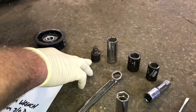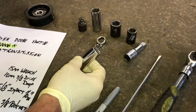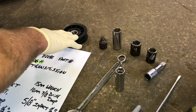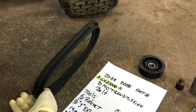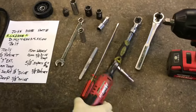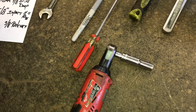I'm going to use an adapter because I'll be using an electric ratchet. We have a 15 millimeter for the back guide on the transmission — we have to take that off. We also have to replace one of these pulleys. They only have a flat idler and a V idler on John Deere's website and you'll see why we're doing the V idler. This is the transmission drive belt, and I'd recommend when you take the old one off, measure it up with the new one to make sure you got the right belt. I have my electric quarter-inch ratchet with a 10 millimeter socket to take the bracket off the side of the engine for the electric PTO.